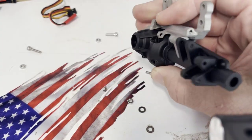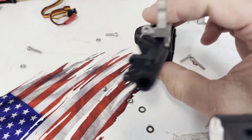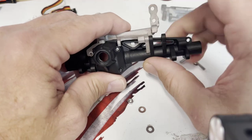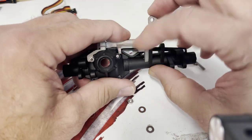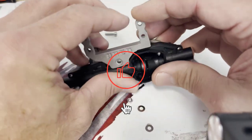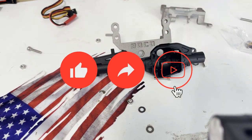Once it's on there, you're ready to go. As with most servo mounts, the easiest option is to install everything before you slap it onto the rig — mount the links, mount the servo, get everything going, and then you'll be ready to rock. Hope that helps. Y'all have a good one.